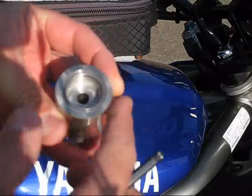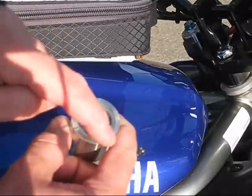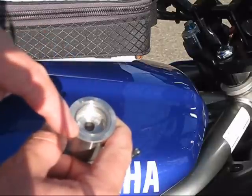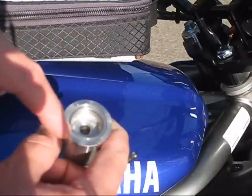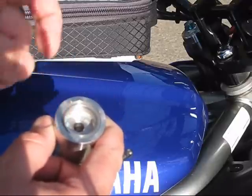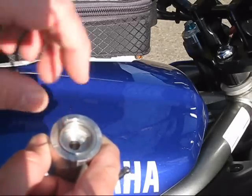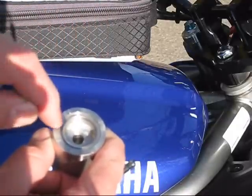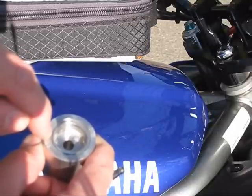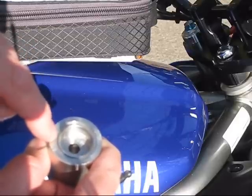Here's a little detail about the throttle lock when it comes to those throttle sleeves. You see here that this surface on the outside of the end of the collar is what engages the rubber grip. It's not supposed to engage hard plastic or metal or chrome — just that nice soft rubber grip. To make room for the throttle sleeve, there's an inner cutout right here that tries to swallow up some of that throttle sleeve. So that gives you a little bit of allowance, but if that allowance is not enough and the throttle sleeve sticks out too much, you've got to find a way to either cut it down or move the grip outward.